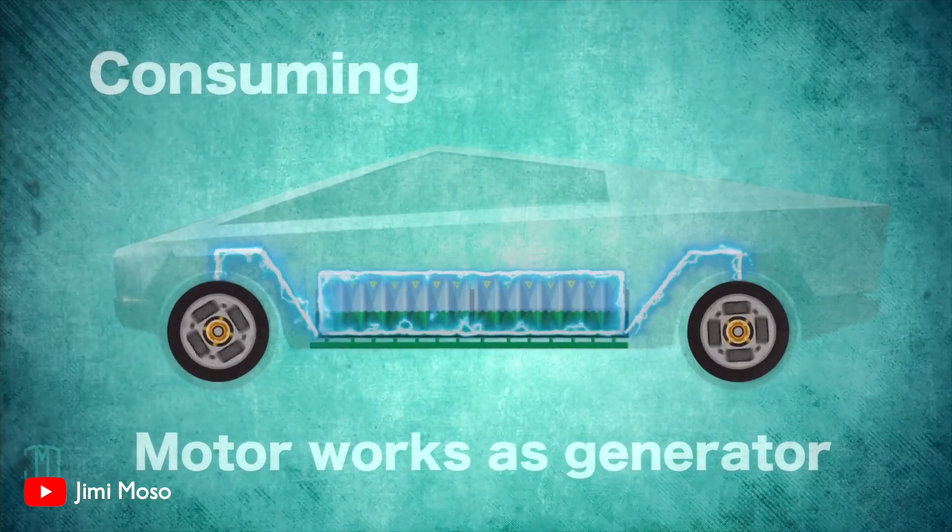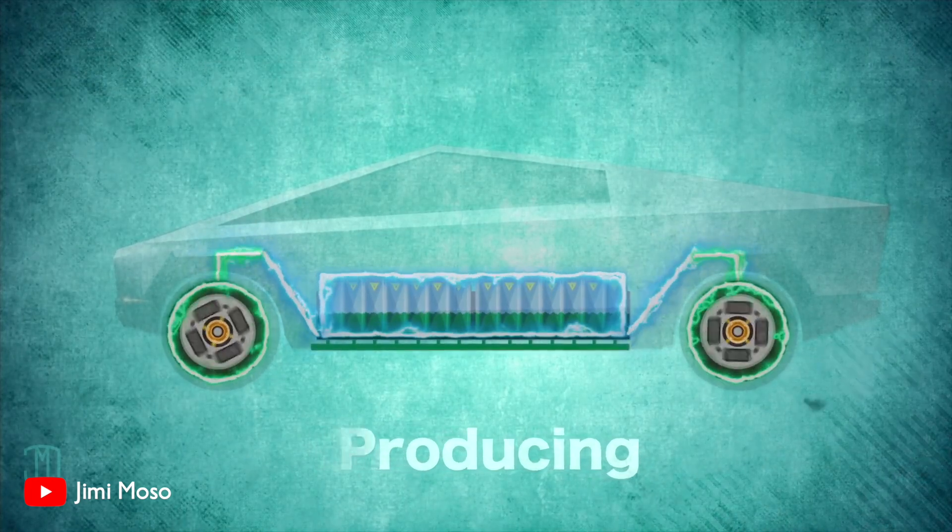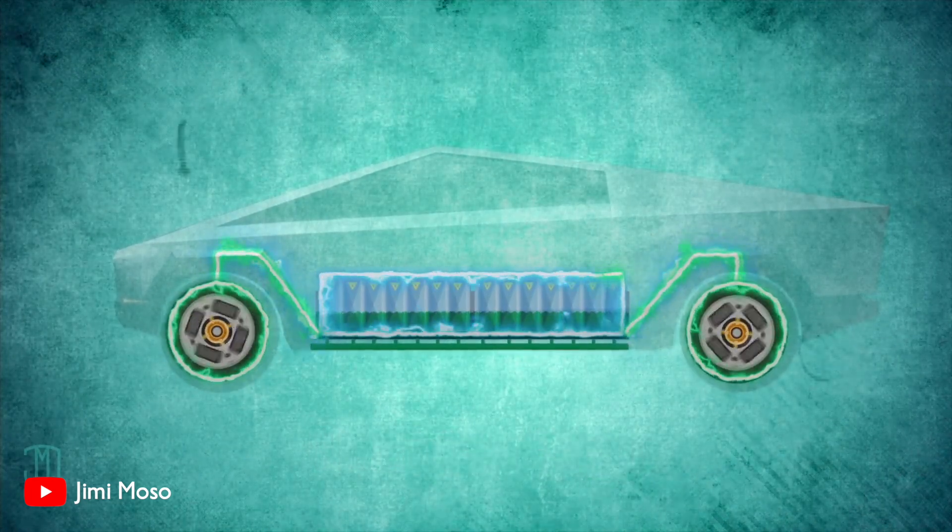We basically use the motion that a scooter already has, and we start shooting that electricity back into the controller and then to the battery pack. That's going to recharge your battery pack up to maybe 5 to 10%. The really big advantage, though, is that there's no wear and tear — the lifespan of your motor is maybe millions of kilometers. Waters and dust won't affect any of it, you don't have to replace components, so it's overall brilliant. It's a brilliant concept and that's why we strongly believe in it.